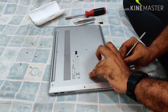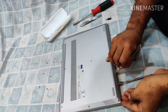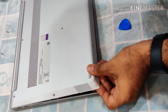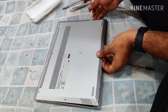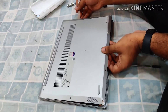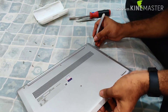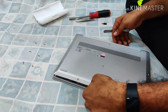I'll put one of my tools here and continue prying this out. This should come like a Lego. One thing to remember is to be as gentle as you can, because sometimes there are latch-like connections here which are very fragile and can break. If the case is not responding and not opening with initial pressure, you have to be very gentle — I have broken a panel like this before. That's just some advice.